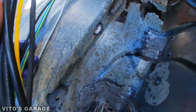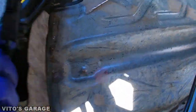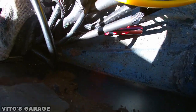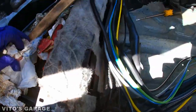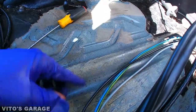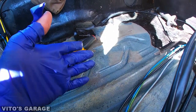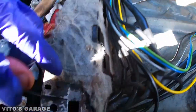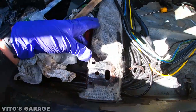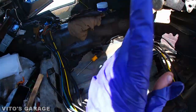It's all pretty much removed now. That's what I'm talking about — you've got to make sure there's no rust where the cross member sits and check under those wires. You really have to check all this stuff and repair it. Also if you're using a pick like I was, there's a lot of scratches — not a big deal — but if you went too deep to bare metal, you want to protect it and paint that over so it doesn't rust. The plan for today is to remove all this rust, paint these areas, and then put the seat back on.